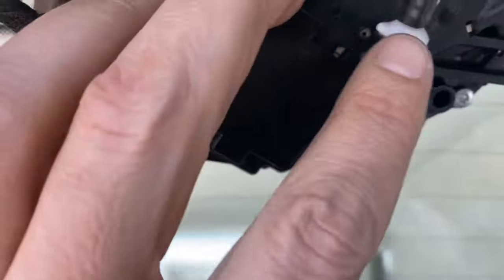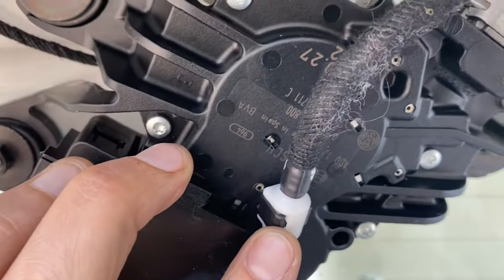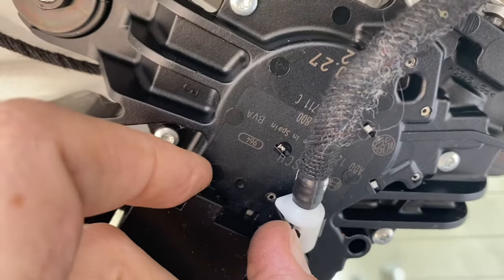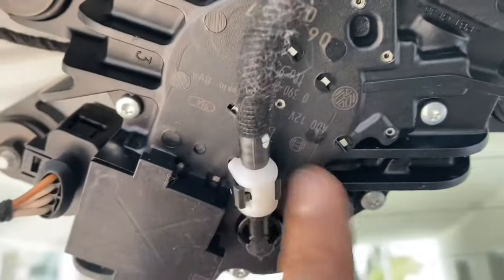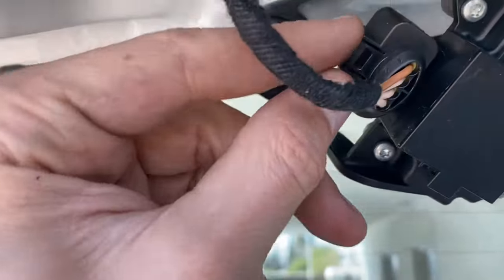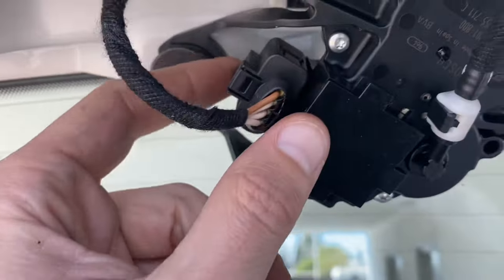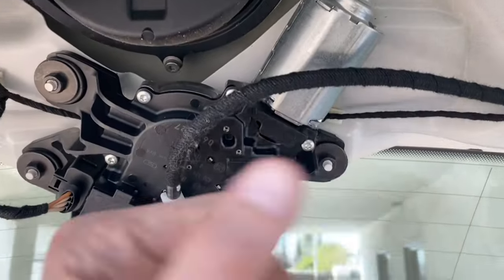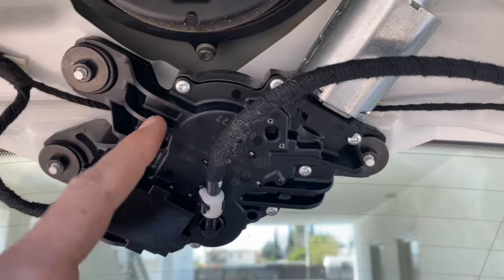Back under the hatch — this is your washer fluid nozzle. You can see there's just a little retaining clip like this, so I'm going to remove that and pull this guy off. A couple drops might come out, no big deal. Then you have one of your push-pull connectors. We'll do these three, pull the motor out, cut the leg off, and move on to the badge.